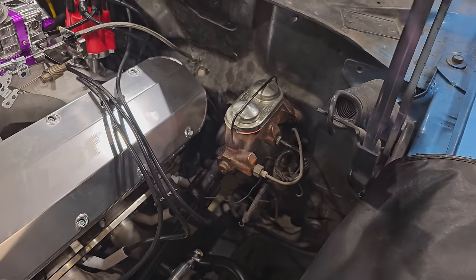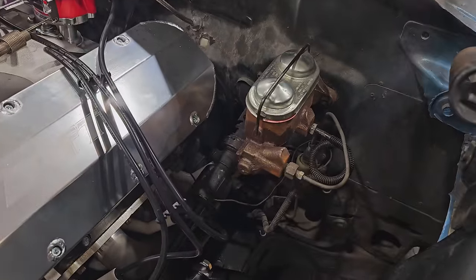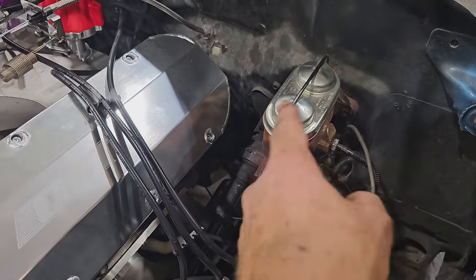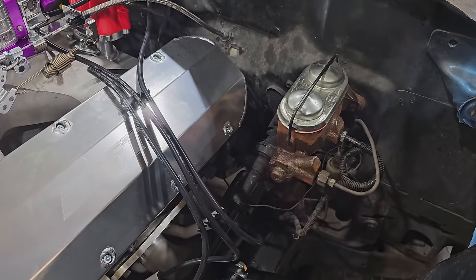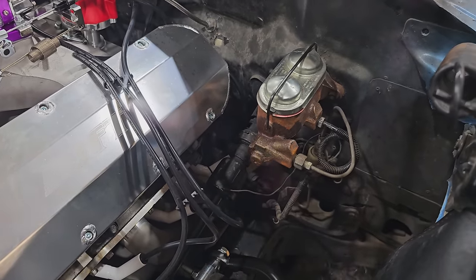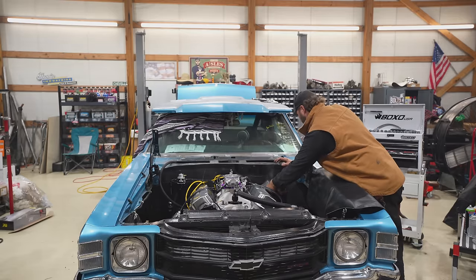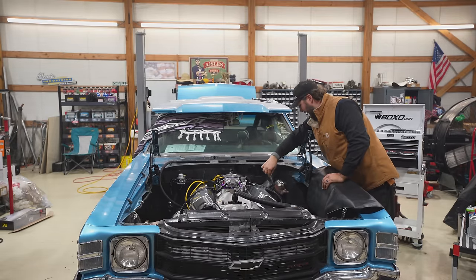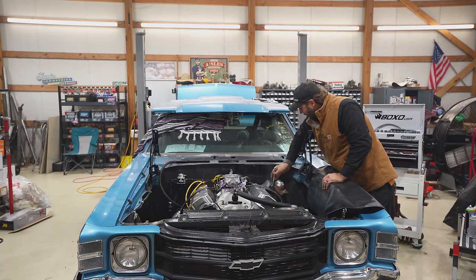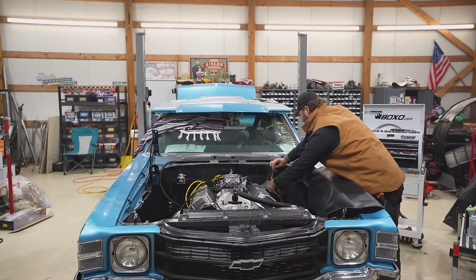So I'm finally back to my primary objective that we started this morning, which is get this brake master cylinder out of here. Just gonna knock these lines off quick, pull those two bolts off, and then I'll show you what we got as far as rod and the piston and the brake master cylinder, because we'll have to adjust the bayer to match. My guess is we have a longer shaft in here, or rod, but we ain't gonna know until the crow makes the bread, or whatever that saying is.